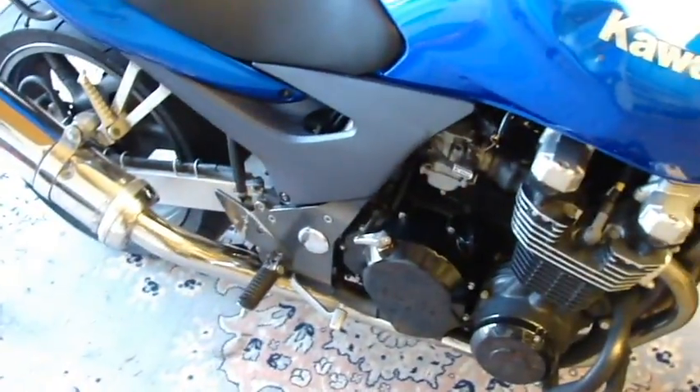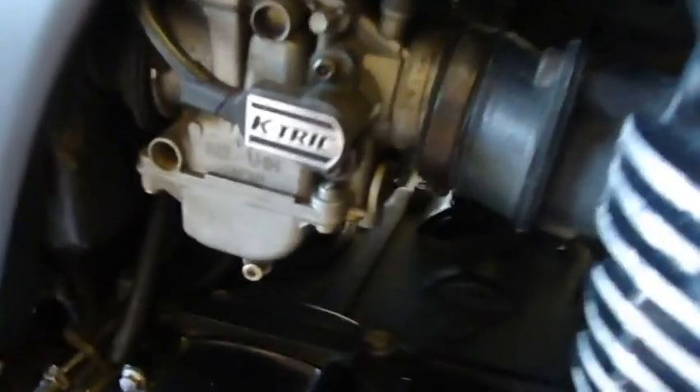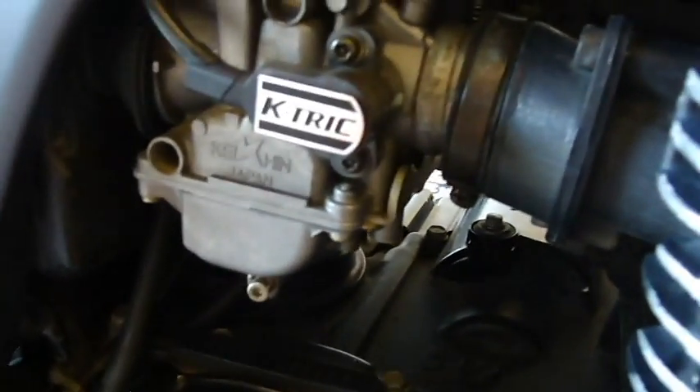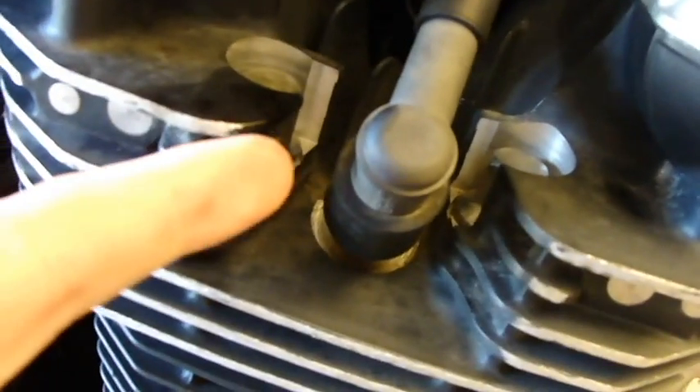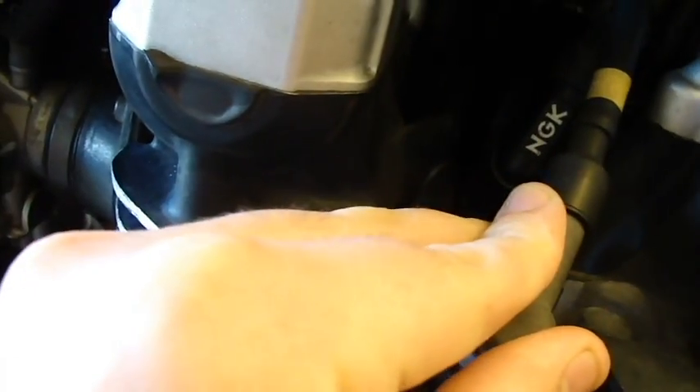Rides really straight. I put new brakes on it, change the oil every three months, and I just clean the carbs and everything — it's running awesomely. I did swap out the spark plugs recently; I only put two NGKs on there, the two insides, because the two outsides seemed like they were alright.